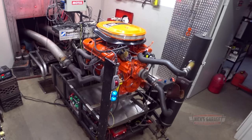It's just that the second you start adding things on, it starts slowing things down. On my Kowalski motor, I remember putting the air cleaner on. We went from a very low 400 to a 399.7, and I left it at that. We did a few tests. You lose a few. I couldn't pass the 400. Again, you're restricting airflow. The second you restrict airflow, you lose power. And you know the air filter element? That's a factory piece. Look at that.